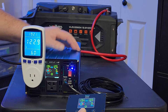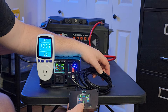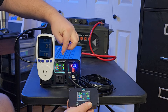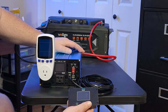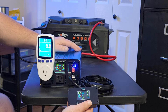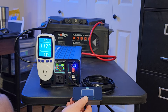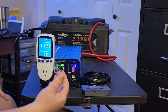The way you lower that down is right here on the remote — there is a button right there in the center, and what you need to do is just hold it down. It makes a really loud noise and an F13 code pops up on the screen. I'll go ahead and turn it off, and hopefully when we turn it back on it'll change the voltage. And yes — 112 volts. The wattmeter shows 112.6, so that's right where we need to be. By switching from 122 to 112 volts, that puts you right where you need to be.